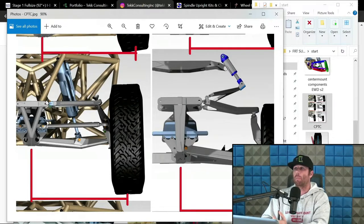Now, when it comes to beams, I do like things a little different. I do like to be 1 to 2 degrees if it's like a street beam, but I rarely like to cater to that. I mean, you're talking about like a street queen, so to speak. For more of like the race truck stuff with beams, I like to push that up to 4 or 5 degrees of negative camber at ride height. I feel like getting that excessive camber gain at compression gives you some really phenomenal bite. Again, that's how I feel.